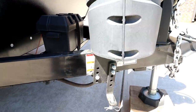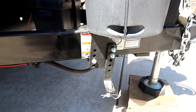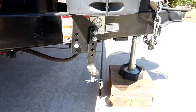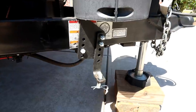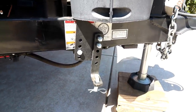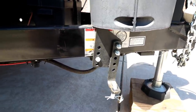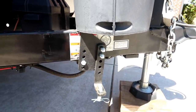One last con with the Blue Ox: I had to move my propane forward to allow the proper clearance for the trunnion bars, spring bars, and saddles to fit. You're supposed to have very specific measurements back here — I think it's 20 to 24 inches — and neither measurement would have worked with my old location of propane tanks. So I had to move that forward. Kind of a pain. Not all of you will have to do that, but I did and I didn't like it.